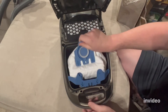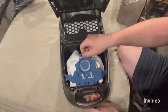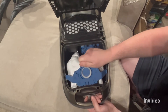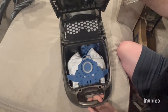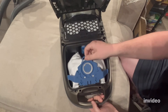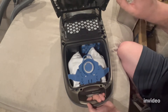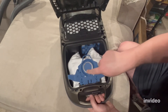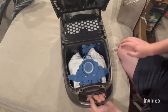Another reason this can happen: here's the dock — it takes some pressure. You can put it in halfway, and it takes some pressure to actually click it into place so it's seated properly. Once it's seated properly, the arrows line up. If you close the bag compartment and open it again, sometimes it will pull the bag out halfway. If you open this bag compartment and don't push this back down into the dock, you might be able to force it closed — and then the next time you use it, since the orifice is not lined up with the port, it fills the bag compartment with dust.